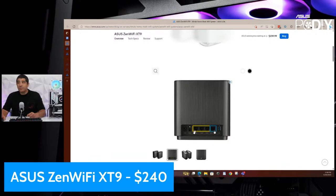You do also have USB there. So if you want your own local NAS type of drive setup, connecting something like an external drive to that USB port, you could have a network based USB drive that's easily available, powered through the router, which is pretty cool. And then those 3 wired connections can actually work in a lot of different ways. Some people go, what's the point of having that there? And you might have what's called a media bridge kind of configuration.